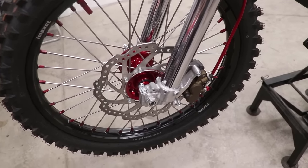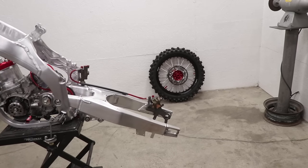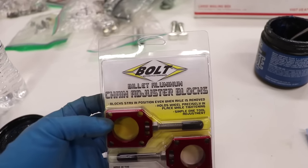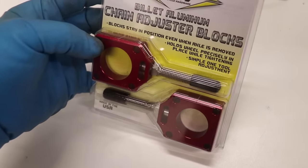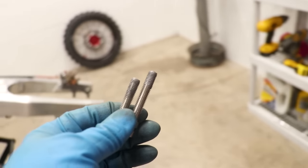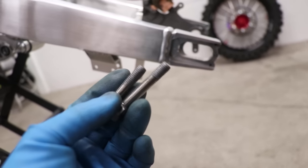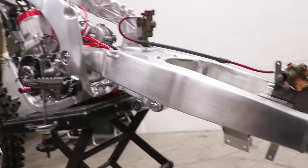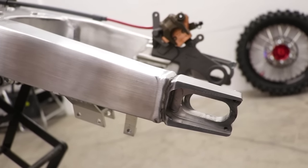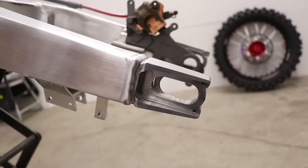It's easiest to align the forks when the bike's all together and on the ground, so I'm going to leave this axle nut and the pinch bolts loose for now. I've got to get these axle blocks threaded into the swingarm — never used these before. They're from Bolt and it looks like they've got a bolt kind of built into the block itself, pretty slick setup. With chain adjuster bolts you absolutely have to have anti-seize lubricant on those threads. These ones already came applied with anti-seize. It's very common for chain adjuster bolts to be stuck in the swingarm — when I bought this bike the original bolts were stuck in there and I had to torch them to get them out. Go grab some anti-seize and throw it on those chain adjuster bolts — you'll thank me later.